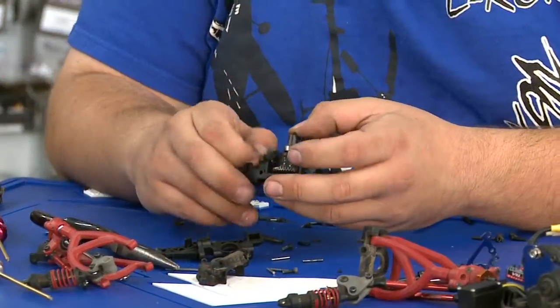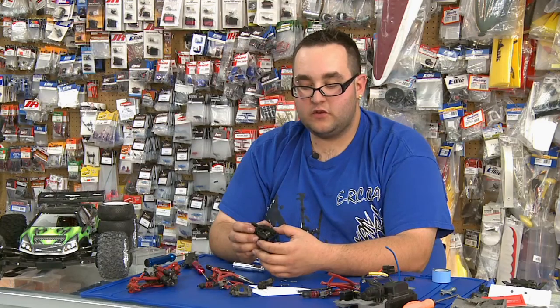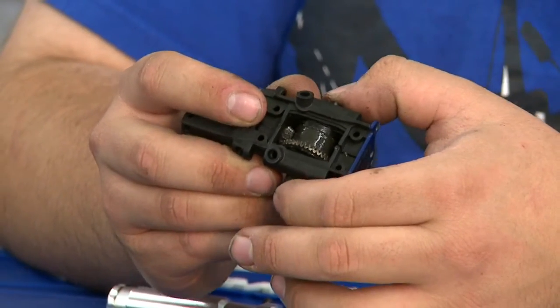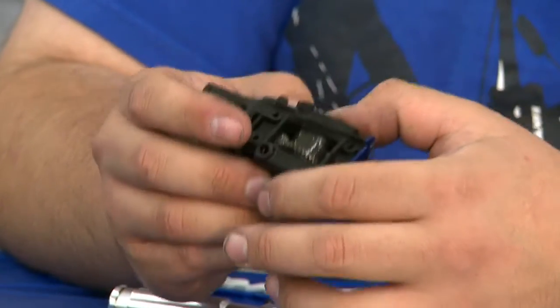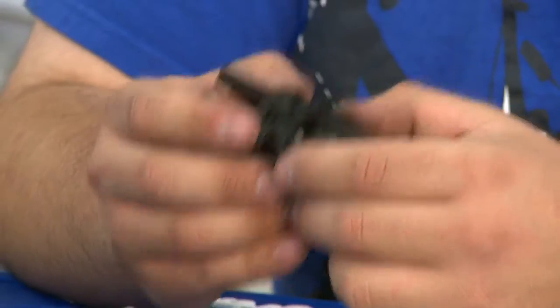When you reassemble your gearbox, it's usually crucial that you check for shimming. What you should do is try wiggling your differential back and forth. If you look at this one here, it has a little bit of play. For optimum performance of your diff gears and longevity, you should shim it closer to the pinion, and it'll stop you from having to replace your gears prematurely.